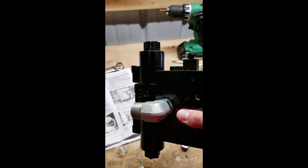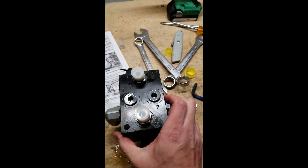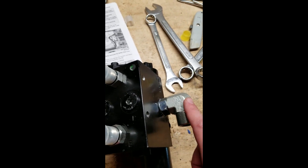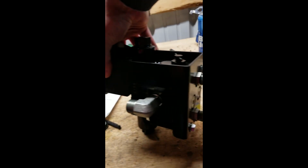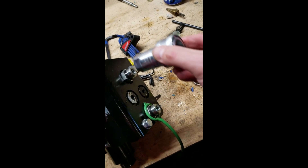Here are the valves placed inside — the one oriented back has two unions, top and bottom, and then the back side for your second hydraulic hose. Note these two are fully tightened already. The housing is in the bracket with just two bolts, and I used a 13mm. Next, the dust string goes on there, then the actual hydraulic coupler, which screws onto both of those fittings.